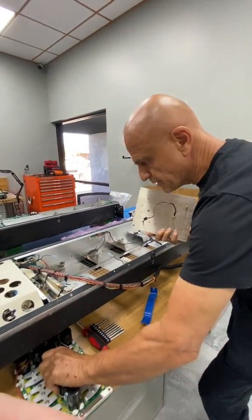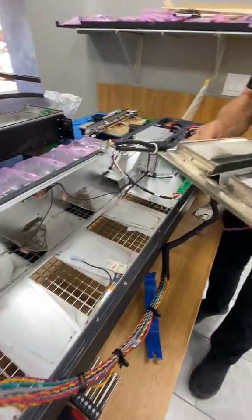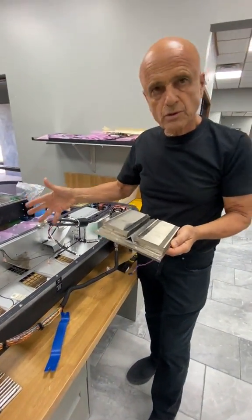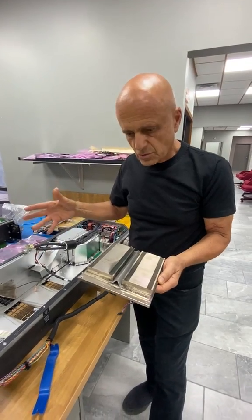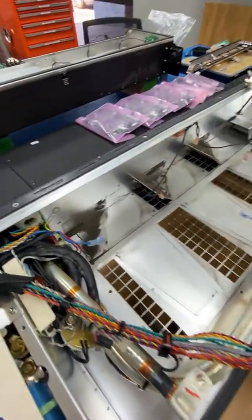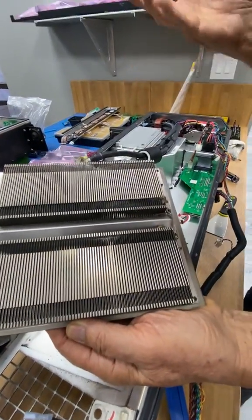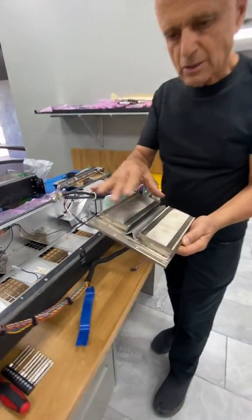What also bleeds off the heat are fans underneath the PEM that blow through these fins, kind of like a condenser fan. What we're finding now is with these older PEMs — the ones that are 14 years or so — that have had annuals every year at the Tesla service centers, the buildup of debris gets to the point where we now have overheating problems. Here you can see one that has been blown out every year with compressed air, but has not been disassembled like this to clean out the fins.